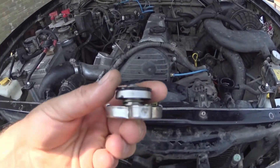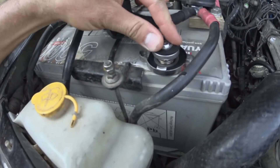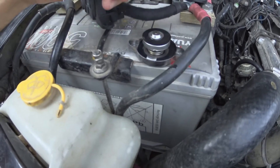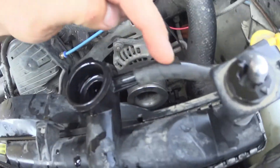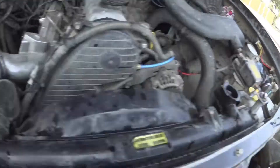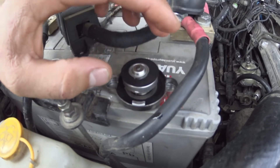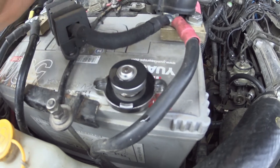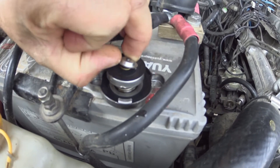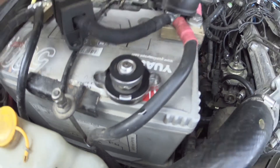The rad cap has a spring, and that kind of sits on it. So if you imagine in the radiator — when the pressure gets above 16 psi, that lifts off and lets the water out through the side hole into the puke tank. And once it's cooled down, this is stuck shut. The coolant contracts as it cools down and draws a vacuum. And now this little guy opens under vacuum, and allows the coolant to get sucked back in from the puke tank.